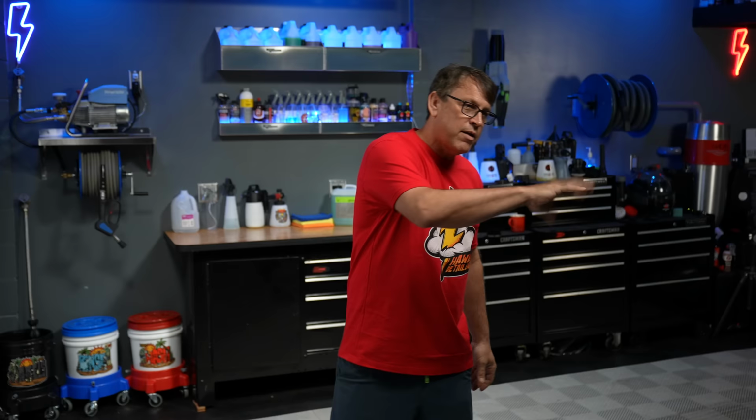test before you go guns blazing all over the vehicle, spraying a powerful cleaner around and damaging your surface. A lot of times on different YouTube channels, you'll see people spraying down a farm truck and then they run a hose over it and everything melts off. And then someone that has a Lambo or something nice is thinking, wow, that's gonna make cleaning easy. There's consequences to the high pH products. If it dries on the paint, it'll leave spots. Too much product and not enough water, I'm telling you what, it's gonna damage the surface.